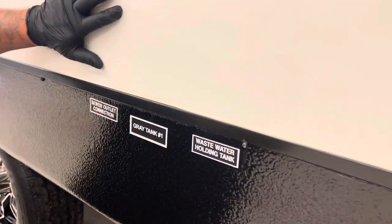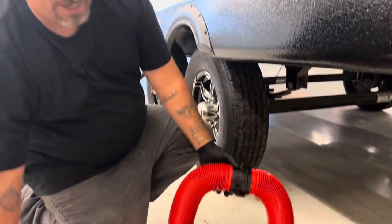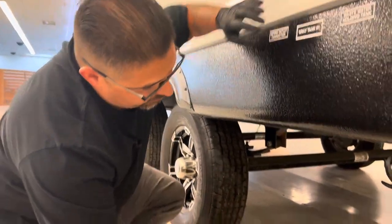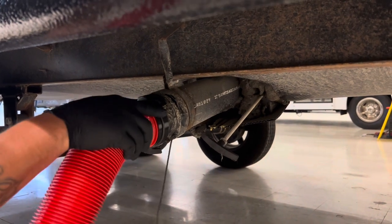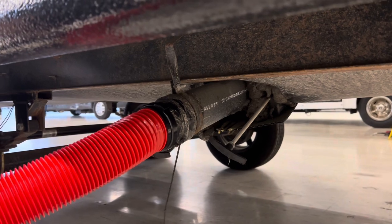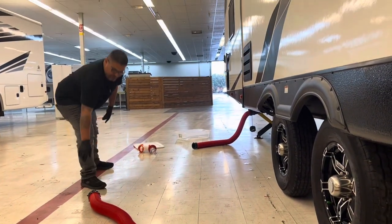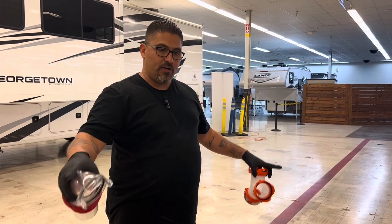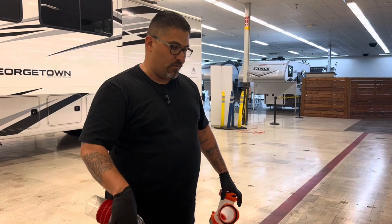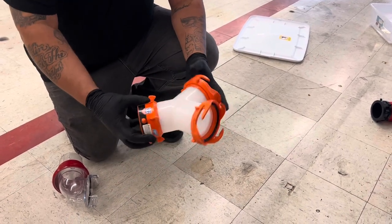Now we are at the rear. We're going to hook up our other sewer hose here. This coach may come equipped with two sewer hoses for the length — it may or may not. Make sure these two valves are closed before opening the cap. Twist it off, hook it in, lock it in, then stretch the hose out. Since we have two exits — one in the front and one in the rear — your campsite only has one sewer inlet to dispose of waste. So we need to connect these two hoses together to go into one exit, and this coach comes equipped with a Y connector for that purpose.